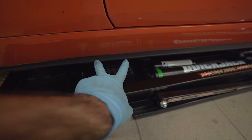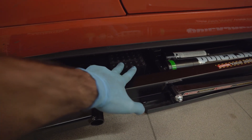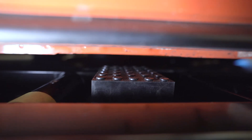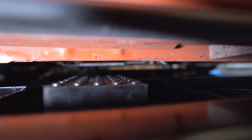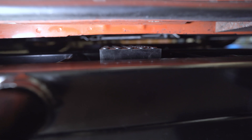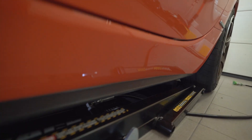For the ND/ND2 with the frames lifting the car forwards, there are two places for lifting blocks on the frame. You need to use the one a little further back — there are two dimples in the pinch weld where the blocks are supposed to be positioned, and it lines up with the second slot on the frame. I've turned the pads lengthwise so they go across and pushed them to the end of the frame so their position is consistent from side to side.